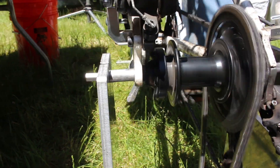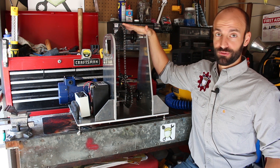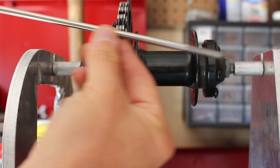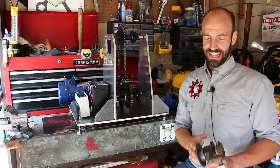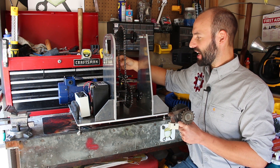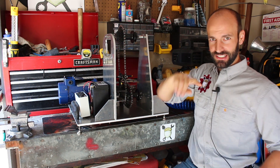In this fourth generation, the idea was to facilitate the changeover by swapping out the back wheel for an axle in the frame itself. This is spanning a long distance — looks like eight or ten inches — so we had to use a 4140 custom axle. You can't get away with any kind of ordinary steel to span this kind of distance. But the problem is the changeover was quite technical. You had to hold the bike in position while you held the driven cassette in position while the intermediary chain was also looped around the middle cassette — really difficult even with two people, whereas with the second generation one person could easily just swap out the chain.